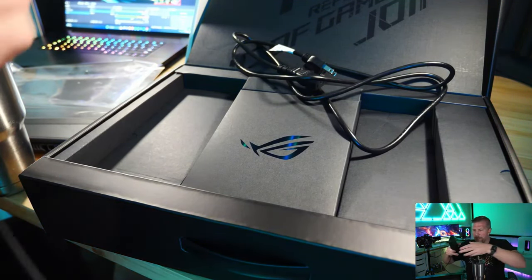Yeah, okay, here we are. All right, so now my Spyder 5 Elite, right? It underestimates color gamut by usually about 9 percentage points. And you can see we're getting 94% of sRGB coverage, 73% of Adobe RGB, 73% of the P3 color gamut. That's very good for a budgety laptop like this, under $1,500.